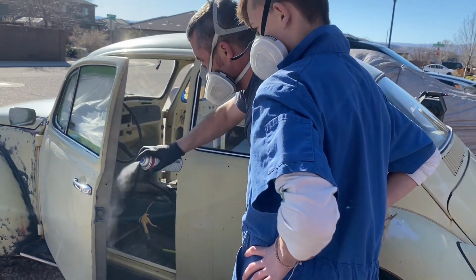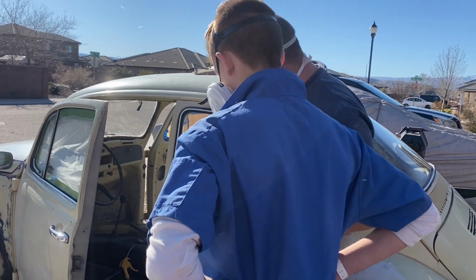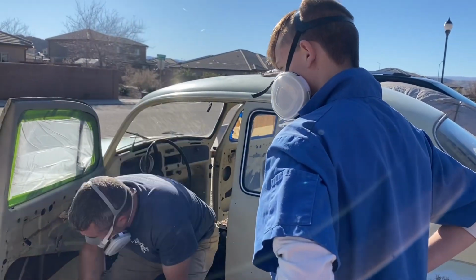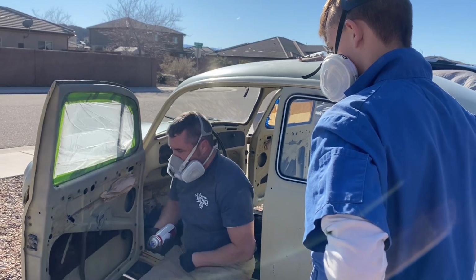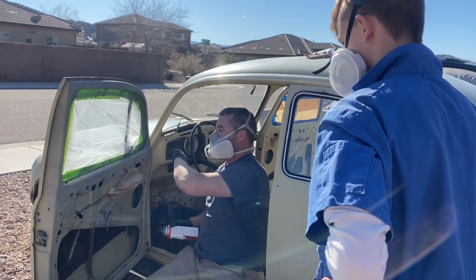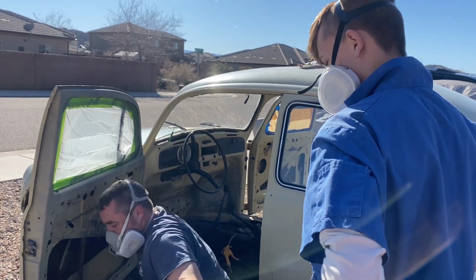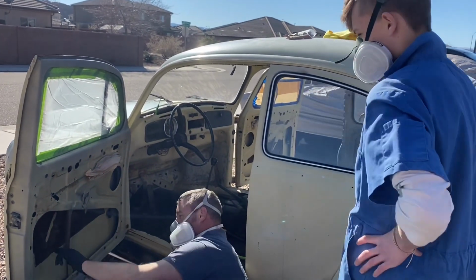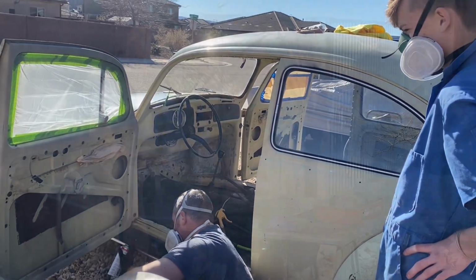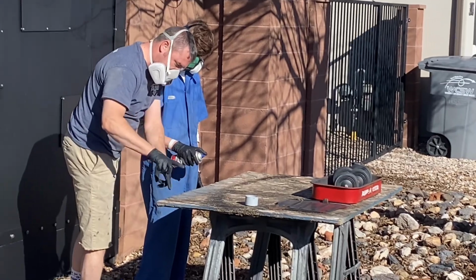When we do a wet coat, we won't do these short little sprays, right? And once it dries, it'll actually just wipe right off. So that is basically our first little guide coat. Because it's so thin, we really don't have to wait very long for the next coat. By the time we get done with the other one, we can go back and start the next one. A couple minutes in between, and it depends on the temperature outside, and it's kind of cold out here, but because it's so thin, until we do the wetter coats, we won't have to wait that long. Okay. Should I go get gloves on? Press and then start. Don't start and stall, because it'll build up right there and it'll drip.